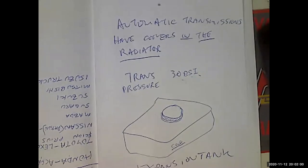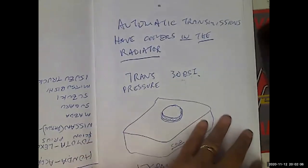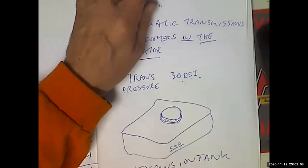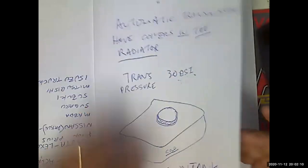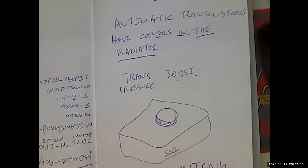Heater core. What do we know about the heater core? We talked about the heater core in this class, right? How it's in the dashboard. How we must protect it at all costs, and how are we protecting the heater core these days, folks? Changing the coolant. That's exactly it, because the coolant turns acidic, and the first thing it's going to go after is the heater core. Why? Because it knows that the heater core is the hardest thing to fix.